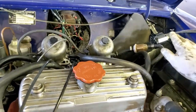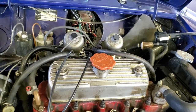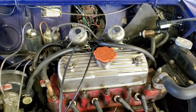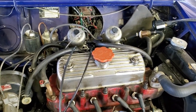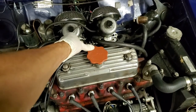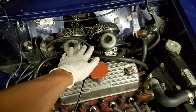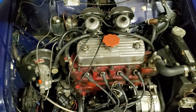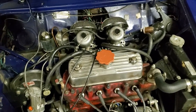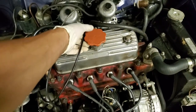I also needed to do a driving test. I had my air-fuel ratio gauge hooked up directly into the manifold — this car had a port drilled for it — so I could check full-throttle acceleration enrichment. I had to do some custom needle work between 4,000 and 5,000 RPM on both carbs; otherwise the needle profile was pretty good. Full-throttle acceleration was 0.85 lambda and part-throttle acceleration was in the upper 0.8s. With the new distributor and curve, this thing now hauls.